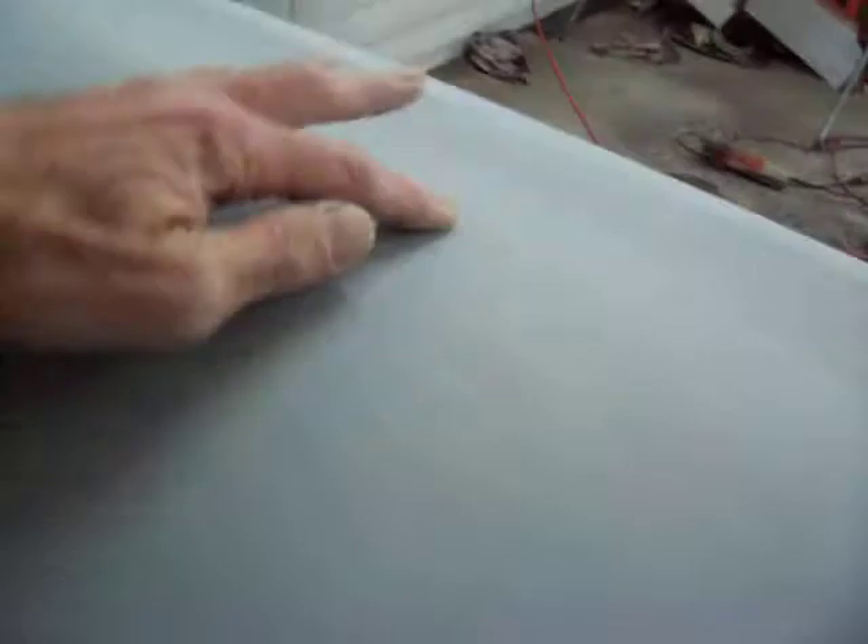The bottom of this one seems pretty good. I ain't got to the other end, but it's the same way. Got a crease down through here from somebody having done some body work. You can see the old Bondo — bunch of pinholes in it, they're going to have to be worked out. We've got the crease right here that's in front of the door handle.